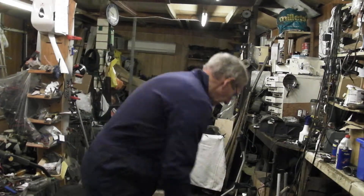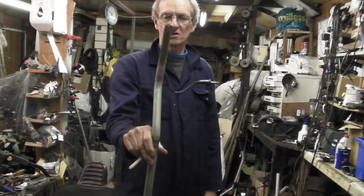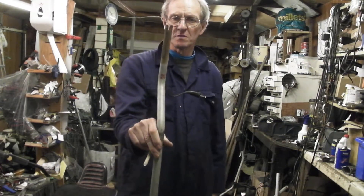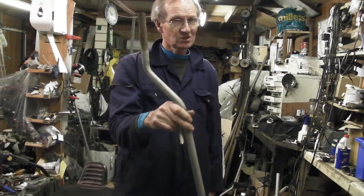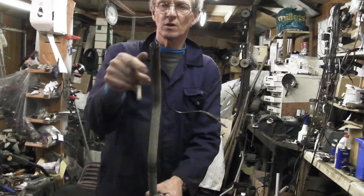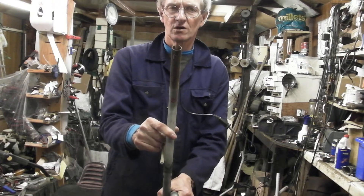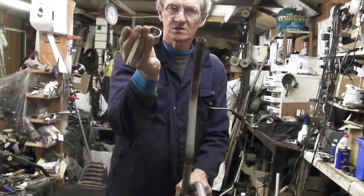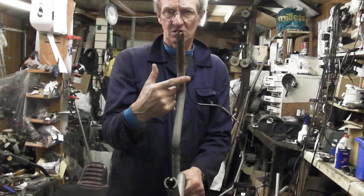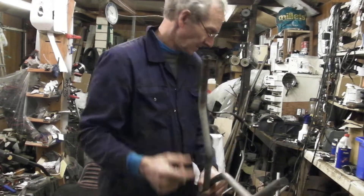If you don't do it, we have a situation on the handle — and we can take this one for example. All of the paint has become worn away from the movement and it's rusted. This is steel, not stainless steel — steel — and it will rust. So when the water gets in you can see this one has rusted. But at the bottom we have this v-groove, which is designed merely to centralise the handle whilst you are tightening up this mechanism. Once it's tight this cannot move. If the cart is unserviced and you haven't addressed the three issues, this will move.